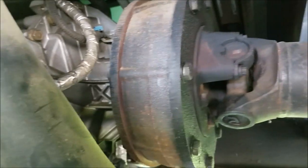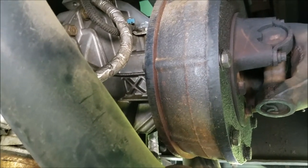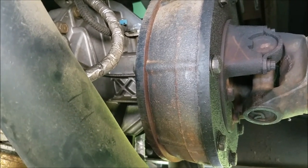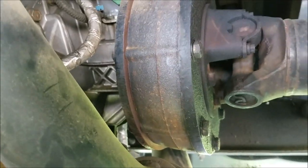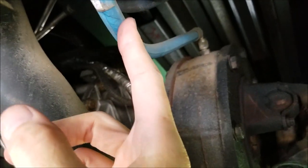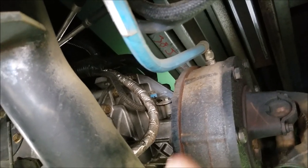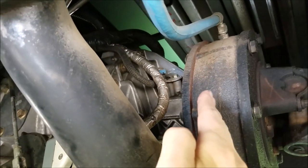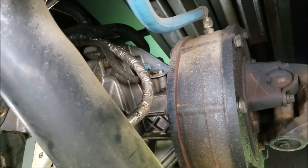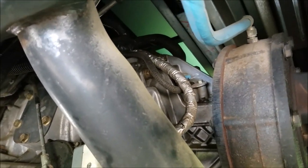The reason they didn't put a parking pawl in this transmission is that this is a 24,000-pound chassis, and they felt the parking pawl wouldn't be enough to hold that weight back on a hill. The way it operates: you've got your hydraulic line and a pump up front. When you start the vehicle and put it in gear, the pump applies 1,200 to 1,500 psi of hydraulic fluid, overrides the spring pressure, releases the driveshaft, and you can drive away.